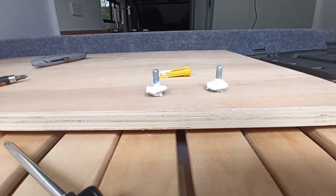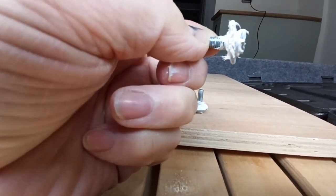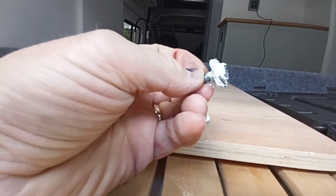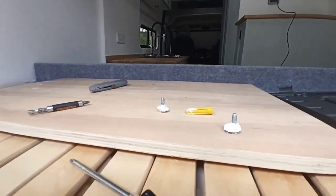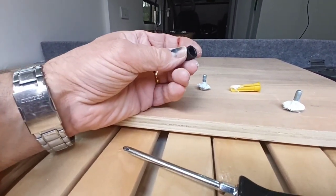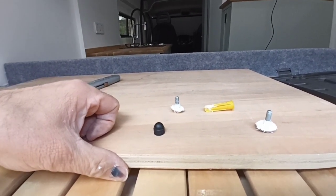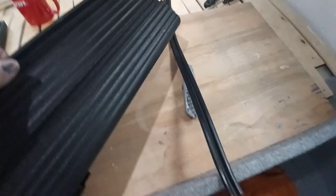These are the two bolts — M6 bolts. There's a large flat washer with PU adhesive on both sides of the washer, so once it gets pushed through and bolted up it'll all squeeze out forming a seal. I'll just smooth it off with a finger. Once it's all in place, I'll spray over the top of them — they do come with little black caps you can put on the head of the nut, but I won't be fitting those. I've got some color-matched white paint so I'll spray all the bottom of the sill to protect the nuts.